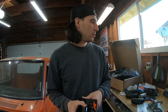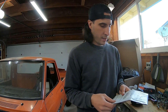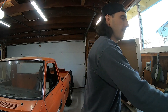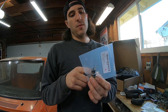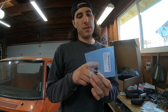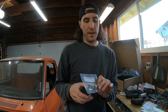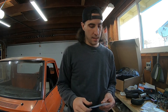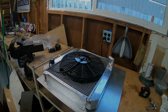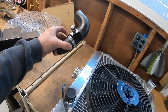I'm using a two-prong sensor from Setrab. It's pretty straightforward — once the sensor hits the right temperature it closes the loop, which trips the relay that starts the electric fan. This one is rated for 190°F, so I'll join this all up and show you how it looks.